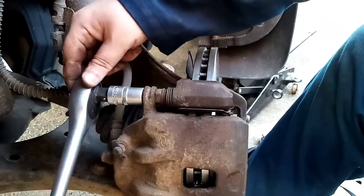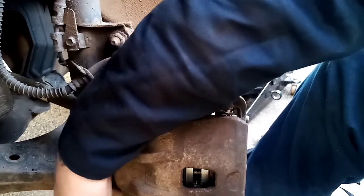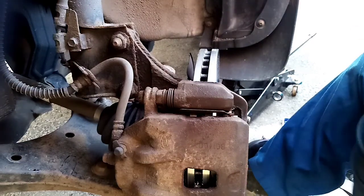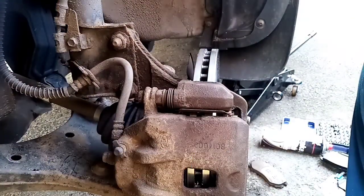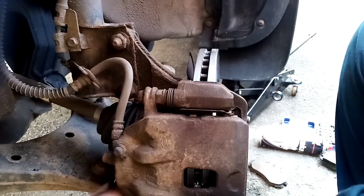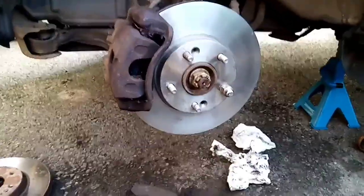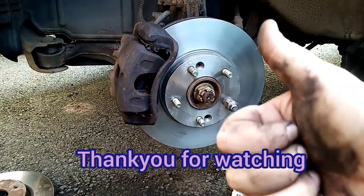This is obviously your 14mm bolt. I will get the torque specs for these bolts and put them in the description. Go around and make sure every bolt is tight, and there you go — you've done your own brakes on your vehicle. Just make sure everything's clean, every bolt is tight, and make sure you don't get any copper grease or lubricating fluid on the actual brake disc or the pads. Torque all your bolts up to spec and you are good to go — thank you.